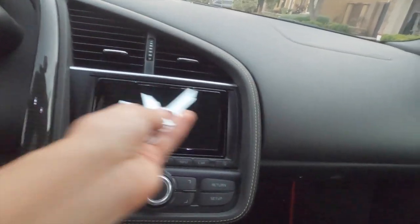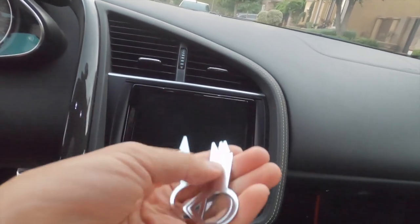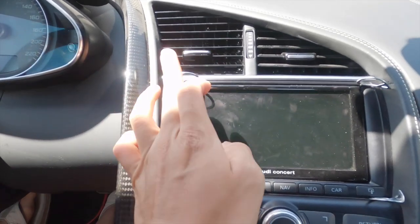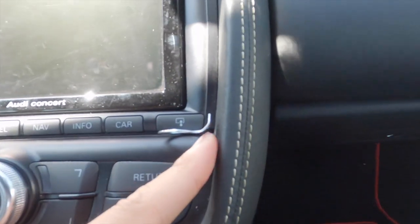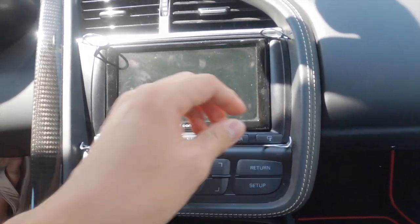Each of the four keys goes into a slot on the four corners and you're supposed to be able to pull it out. All right, it's the next day, and unfortunately I couldn't get it working yesterday. It took me an hour to figure out that these keys don't work even though they're OEM. The top two fit in fine, but the bottom two don't go in far enough. It actually damaged my trim because these keys come with sharp edges and they're curved, so I have to bend them a little bit to get them in — but even then they don't fit all the way. I actually found out this is a common problem for people trying to remove their infotainment system, and you actually have to get third-party ones. The OEM ones from Audi aren't that great.